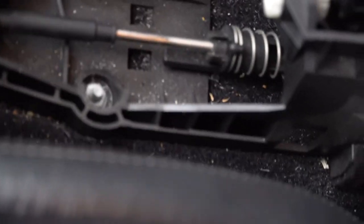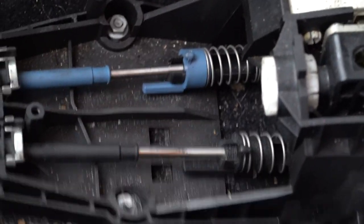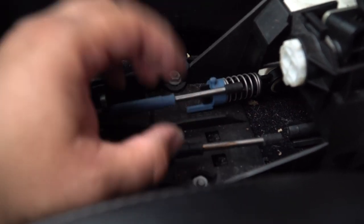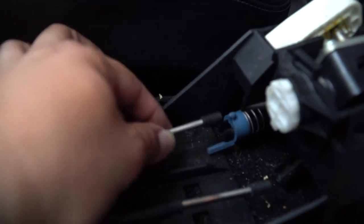To take it out, there's four nuts there, two right here and two in the back over there, and they should be 10 millimeter. Let's do it. Got the four nuts out. These are just hanging on loosely. They should come right out when I pull this. Next we got to do the cables. I already undid them, sorry, but basically this is spring loaded here, so you're just going to push that all the way out so that you can pull this little guy out super easy.